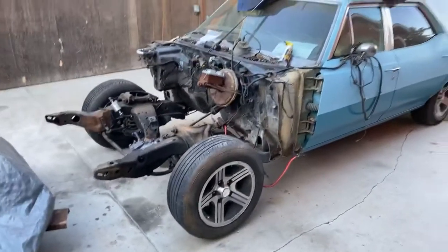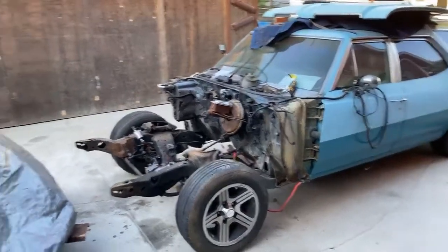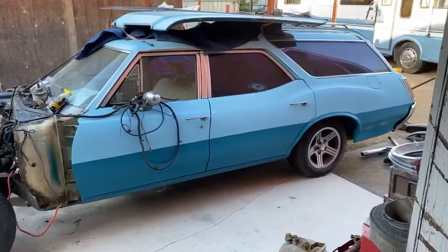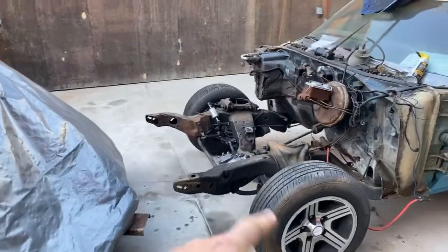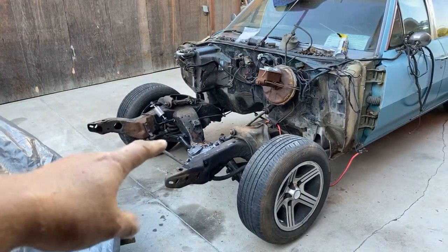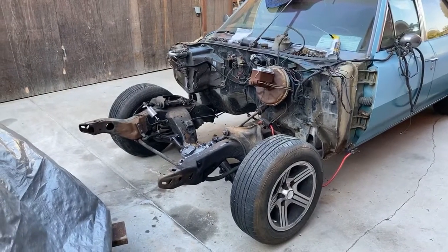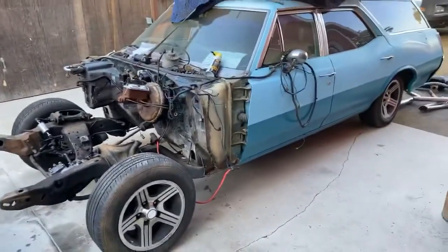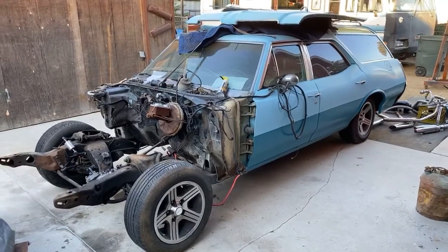And then because my Suburban is getting a little tired, the tranny's going out on it, and I'm not putting another tranny in, it's got almost 400,000 miles on it. So we decided to make this our shop truckster. We're going to put a 5.3 in it, and I bought it from Busa. It already had a bunch of new suspension components, and I had Straight Line Steering out in San Bernardino do the steering box, and we put a new center link on, so suspension and brake wise it should be good. Once we get the 5.3 situated in, it should be a pretty good motivator for it, and we can put a class 3 hitch in the back and some overload bags, and it should be good too.